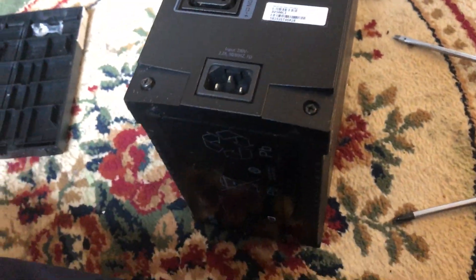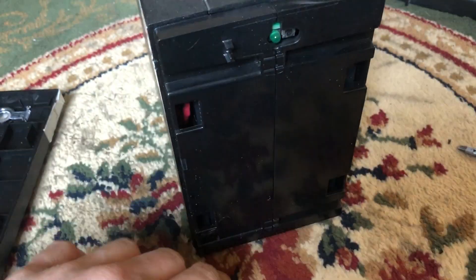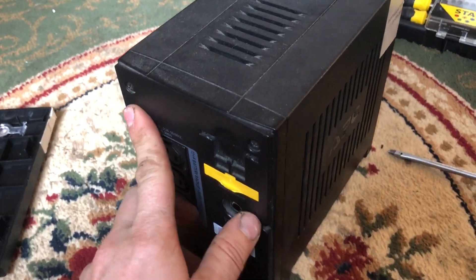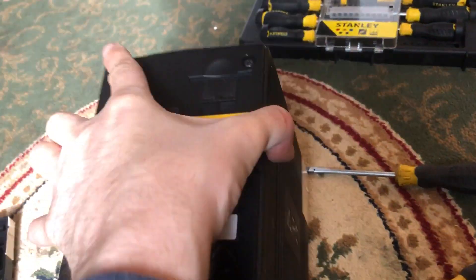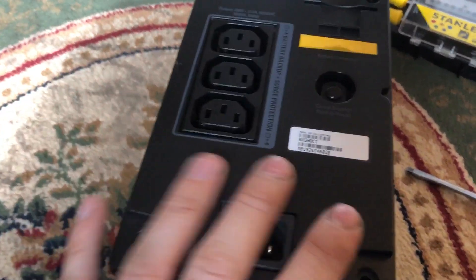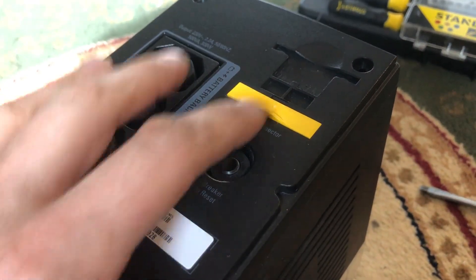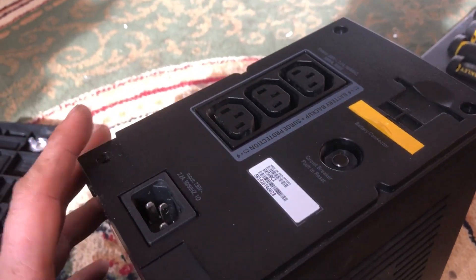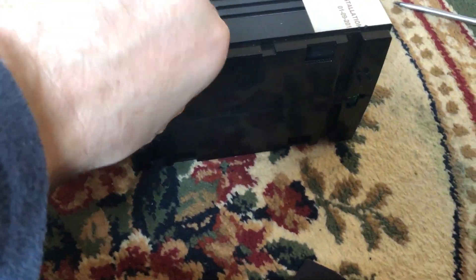The battery is in there — you can get away with just removing two screws at the front and two at the back, leaving the back panel on. However, when you come to refit it, it has to tilt and slot in, so it's best to remove them all. Also, it's worth disconnecting the battery connector so the circuit inside isn't energized — leave it a few minutes. Once it's open, don't touch any of the electronics as there are capacitors in there that can be dangerous.